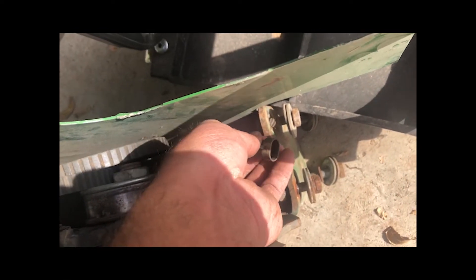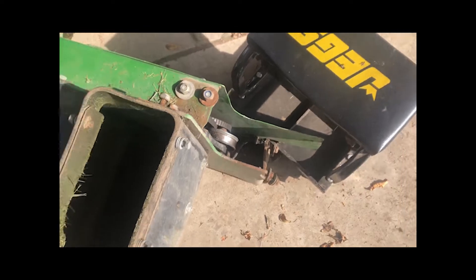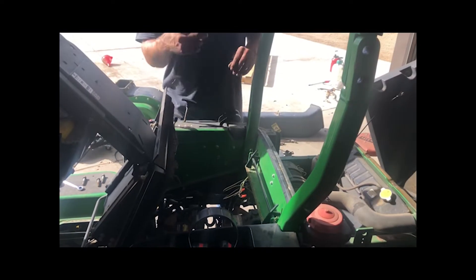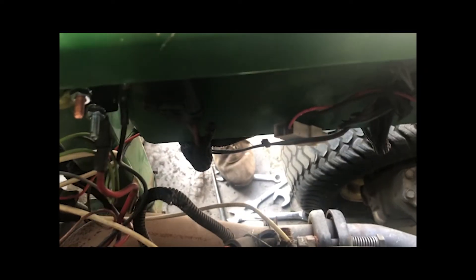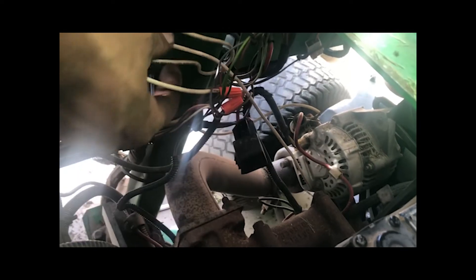Here's a little switch — an electric connector that goes up to the switch. This is how I take off the electrical system. I'll label it when I take it off. So you've got this harness here, and there's a relay on this backside here, and then you have the sounder up here — you just take those off. Then you've got the ground to the alternator too; I'll label it so it won't matter.